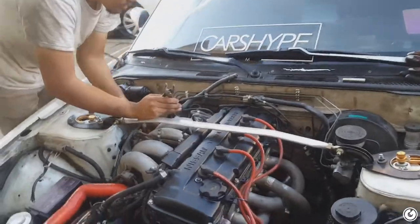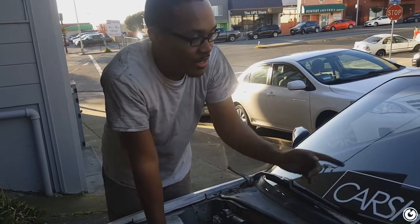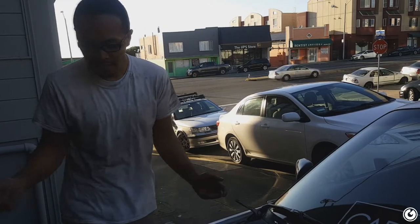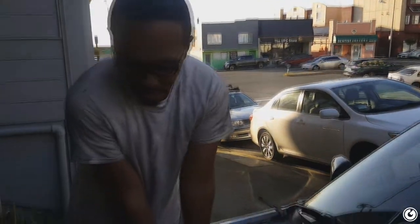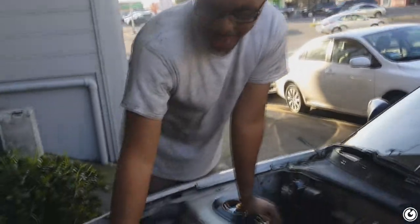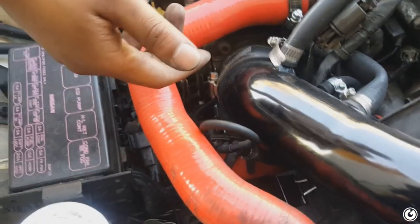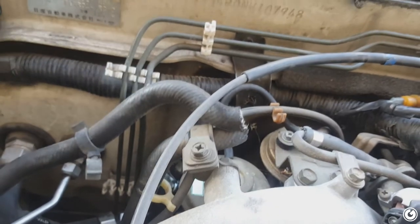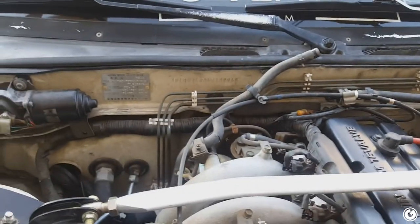So basically as you guys saw it was idling super crappy. We spent about an hour trying to figure it out. I also had a couple of exhaust leaks which I fixed on the bottom side — just had to re-tighten the bolts on the cat where it connects to the 3-inch exhaust. We messed with the distributor and everything. We thought it was the O2 sensor, then I started looking at the back lines we swapped — disconnected the AIV line, it made it worse, plugged it back in and it still wasn't helping. Then I looked around and found this line from the brake booster completely split. When I put my finger to it, it made the car idle perfectly. Complete curveball — wasn't anything we touched today, it just happened to be broken.